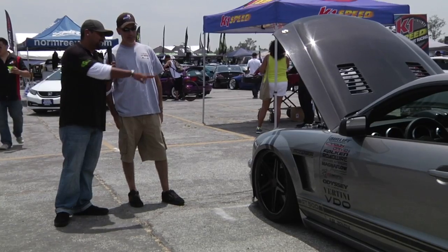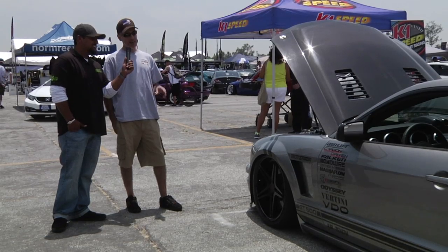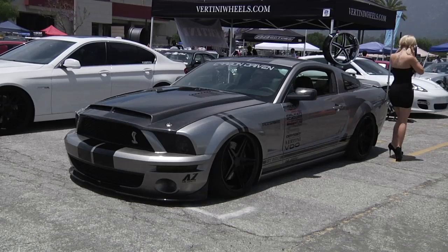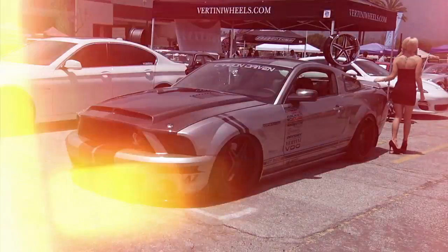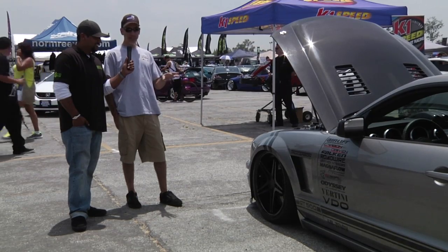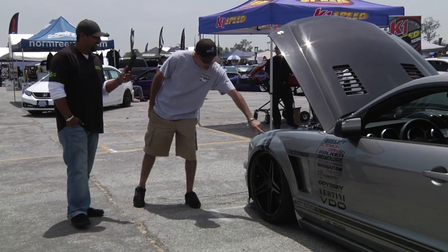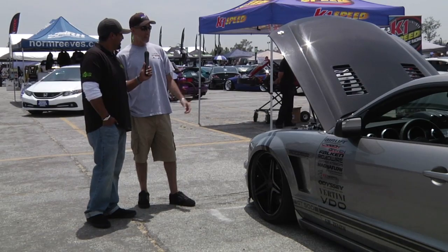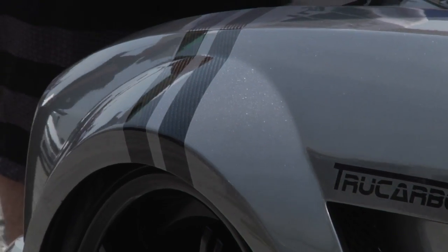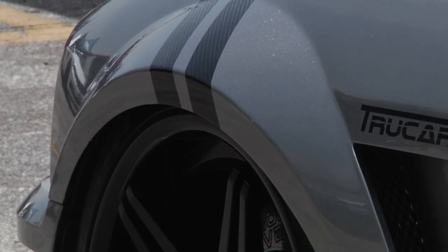Tell me about this fender — I thought these stripes were actually vinyl stickers. It's a complete carbon fiber fender and what I did was a reverse paint job. I had the fender stripes put on, my True Carbon decal put on, and had someone make the GT500 logo decal. Put them all on, then they sprayed it, and after it was done they pulled them off. Color sanded several coats of clear to even it out, and a lot of people always trip out and come up and touch it. They ask how did you get that decal on there, and I tell them it's not a decal — it's an entire carbon fiber fender. When you touch it, it's completely smooth, and you can see the carbon fiber right through the paint. That's awesome and that is unique.